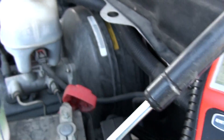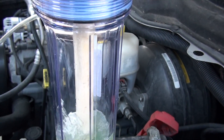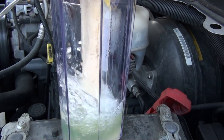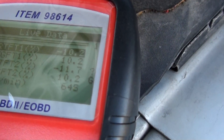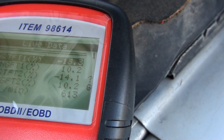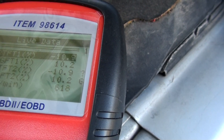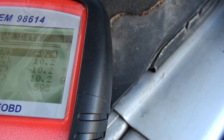What I wanted to show you is when I put this valve — I start to vaporize the gas. Open that up, you can hear the engine changing, RPM changing. So I'm opening that up all the way. Look at my fuel trims: minus 12%, minus 14%. It's taking away fuel.